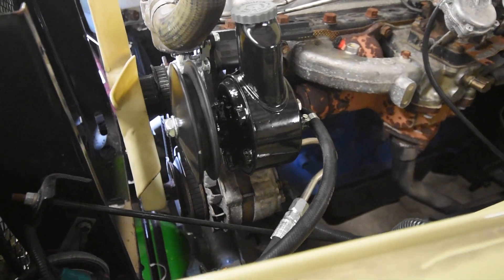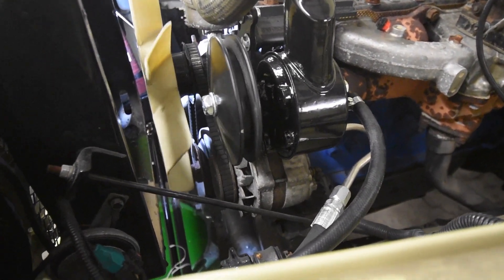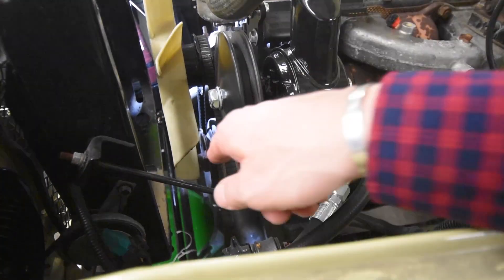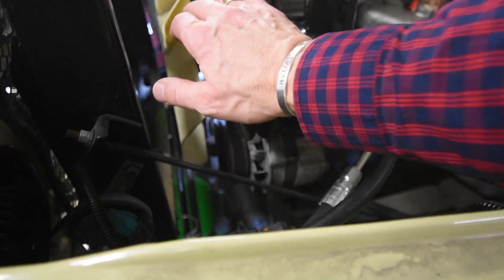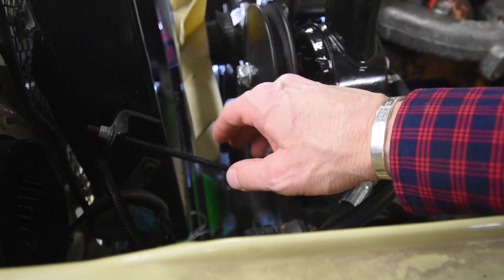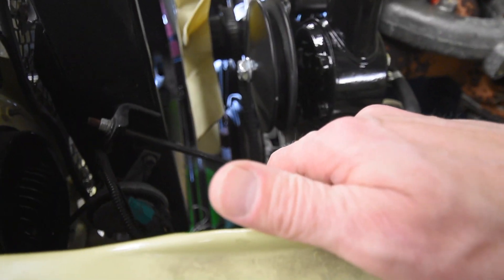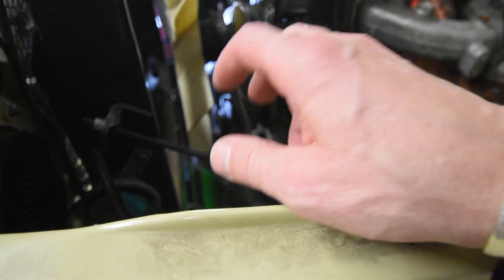One of the things we're doing here is rearranging the front of the engine. Moe's showing me that the balancer is going to have to be swapped out for a dual-groove balancer — it has a single groove because we need to run another pulley. He's showing that the balancer actually moves on the front of the crankshaft. So it's floating, and that's fine because we're going to pull it off and refix it with a brand new keyway and a brand new balancer that has two grooves.